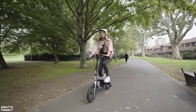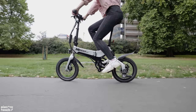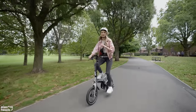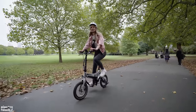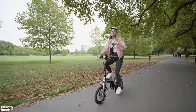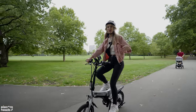What is this bike like to ride? Well, this is where things get really interesting. It is very powerful — although very small, it is very mighty. It's got a 250 watt motor but it really does punch when you are getting off at the lights, and that is all because of the throttle assist. This little throttle here only works when you are pedalling, which makes it legal. If you have a throttle that works without pedalling, that is illegal in the UK — it is legal in the US, just FYI. Because it has a cadence sensor there is a slight delay when you start pedalling, but that little throttle button really does make you go at the lights when you need it to, and I've been having a lot of fun with this bike. It's also fantastic going up hills.